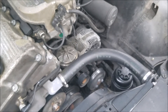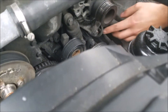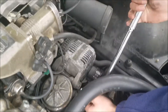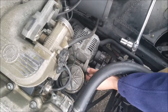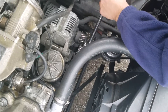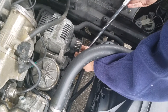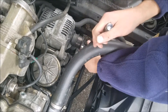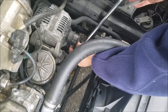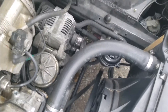This is a really easy job to do. You have two bolts holding in this alternator — one right here and one down here. They are 13 millimeters. You're also going to want to cut power to your battery, because that hot wire is always getting juice to this alternator. You're going to want to cut power to the battery before you start messing with the wiring in the back.